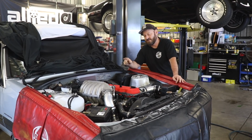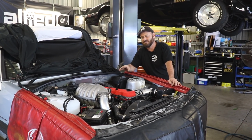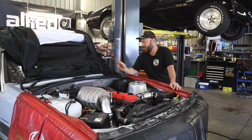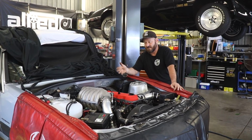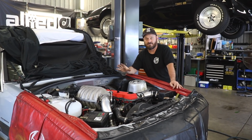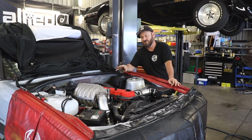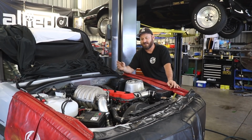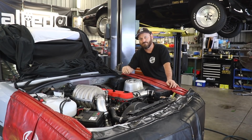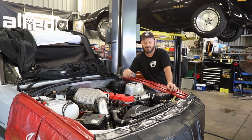Check for leaks. Obviously, if it's leaking, don't go any further, fix it. No fuel leak is acceptable. No weep, no nothing, fix it. There's something wrong. So we go through that process, leave it running for a couple of minutes so anything that could be a problem is exposed, and fix it, because fuel leakage is a serious matter. Don't mess with it, especially when you're trying to configure an engine, because backfiring and flames out the intake and that sort of thing can be an issue, and any fuel leak will not go along well with that for you. So be sensible, use your brain as always.